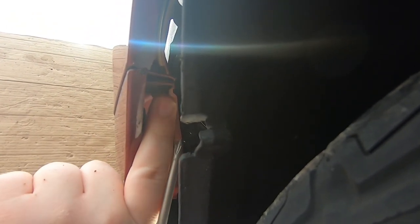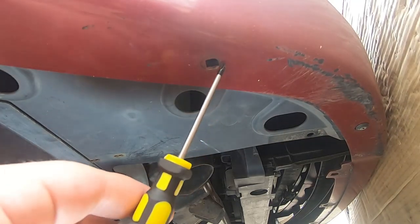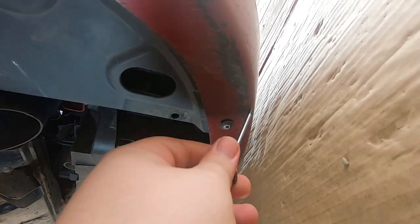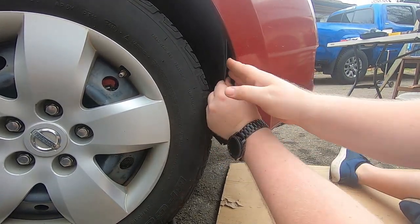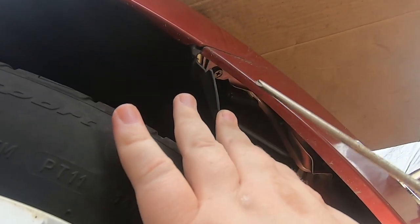There's a screw right here, pretty much at the top of the bumper where the line is — there's a screw there you have to unscrew. Same thing on the passenger side; there should be three Phillips screws. There should be another screw here but I lost my connector piece, so just another Phillips that goes there, and then there's one right here. Once you've got the three screws out, go ahead and pull out the splash shield. You kind of have to bend this back a little bit and then your screw will be right up in here. Once you get the splash guard all the way back, use your Phillips and take this screw out.